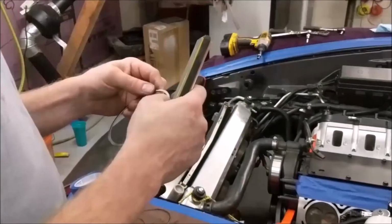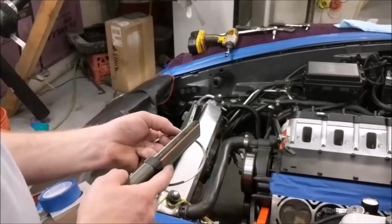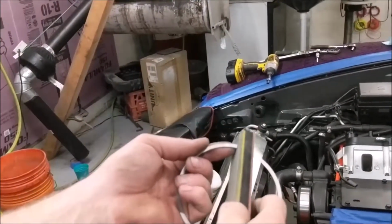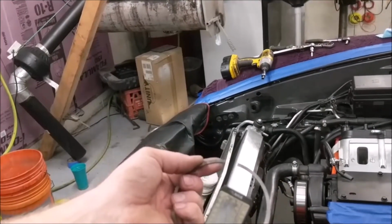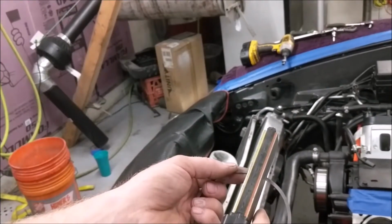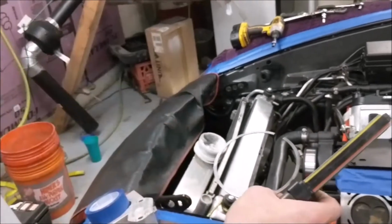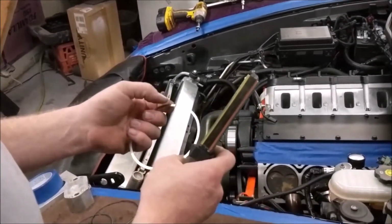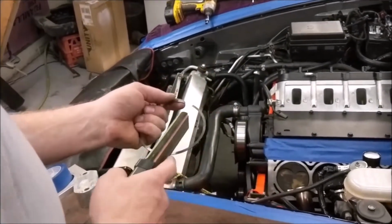Alright, now when it comes to these guys, I actually have to make sure I'm really squared up. So when I'm doing this, I'm making sure that the other end of the file comes approximately to the middle of this, and that'll keep it square when you lay it up against there. The chrome rings tend to chip in that makeshift ring file more so than create a rolled sharp edge. So all I do is hit it real lightly on all corners.